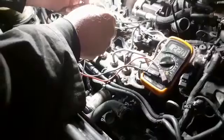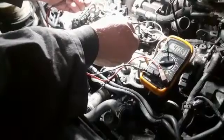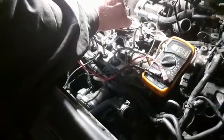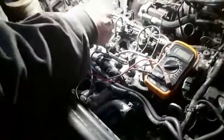I know this one's faulty, that's why we're doing the video. So that one's giving 35 and climbing up slowly. This would actually keep the vehicle running, but what you've got is it's running and stopping. Disconnect one of the electrodes and test it to the body of the injector. If you've got resistance there — which we have — that means the piezo inside the injector is shorting to the body. That will give you the P2146 malfunction to the ECU. Your ECU isn't malfunctioning.